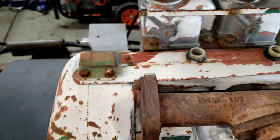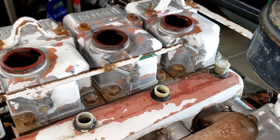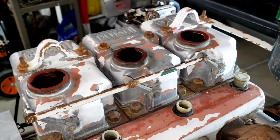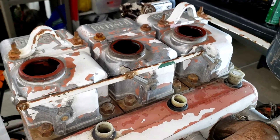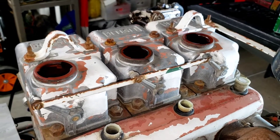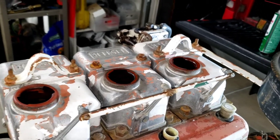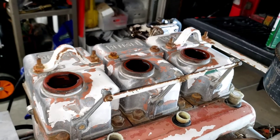The reason for that is these engines are so high compression — probably 19 to 1, anywhere up to 22 to 1 compression — so you would need a decent-sized, fully charged battery to crank this over with enough speed to have it fire. On older, weaker starting systems, you would use a decompression lever. You'd basically spin the engine over with no resistance, and once the engine was up to full rotational speed of the starter, you'd just kick that lever back, which closes those valves, instantly increasing the compression. Then it ignites, because diesel needs the heat from compression to ignite.